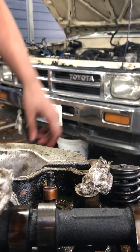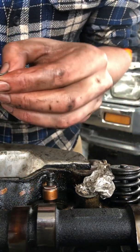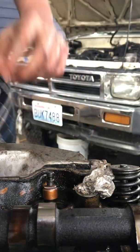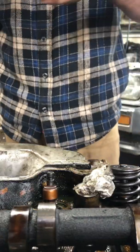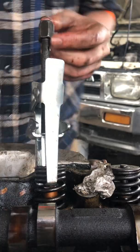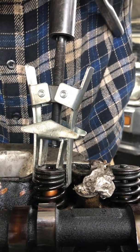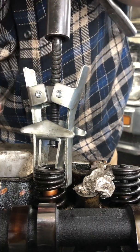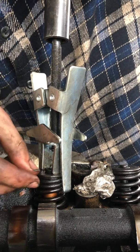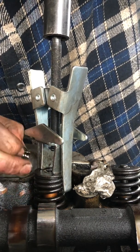One important thing is keep the two holes with the head studs plugged for the valve you're working on. Get your keepers — there's a very minor taper, thin taper, it's going to go in first. Line them back up. Comfort-wise that's a little pain in the ass — stocking on there. Grab your first keeper, make sure that's aligned tapered side down. Give this a good push — start that in there, push it in there, it'll sink.